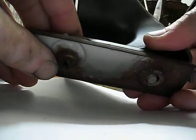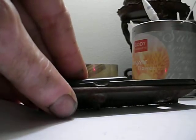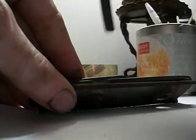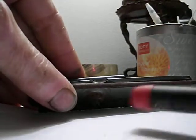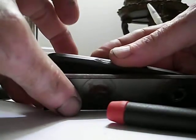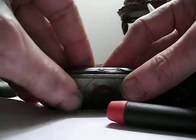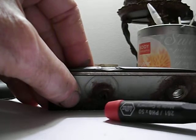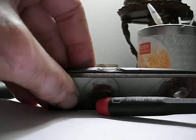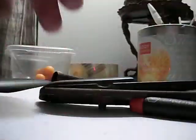Taking it off — first thing you do is you unscrew the nut and pull the whole head shell off. Then, working in a very tight space, get something — probably some kind of a dowel — something thin that you can press with. What you want to do is try to push up here, because pulling it off is not wise. That's what I did and it just snapped right off. The better approach is, if you have access, press up and try to push that pin up. That way you're not tugging on it and stressing out this joint right here where the pin is molded into this piece of plastic. Then this piece would come off. That would be the removal process.